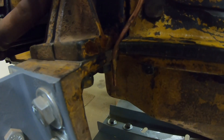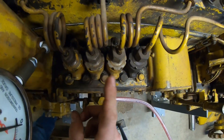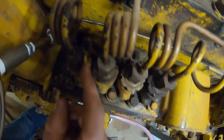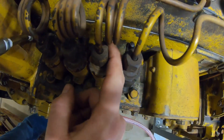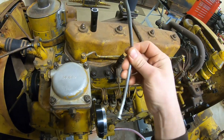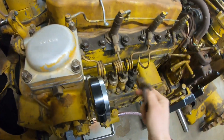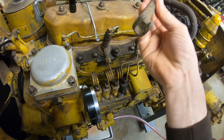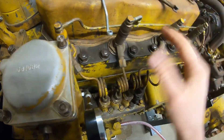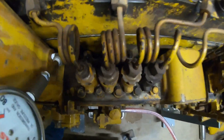Make sure we stop dripping down here — it's slowing down already, that's just what's left in the line. The final points we need to bleed are all four injection pumps. Each one has a bleeder screw just behind the line — those are really fun to get to. You want to have the cap tool here; it's got a couple of different angles, and if that doesn't fit because of these coils, I've got a more old-fashioned cast iron straight-on one. Just combinations of whatever you can find that fits in here is what works.